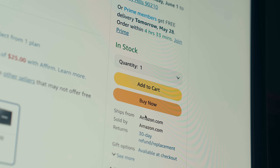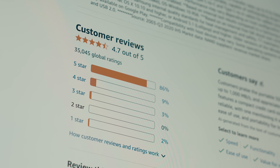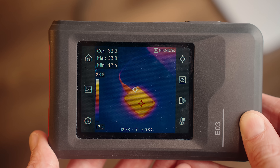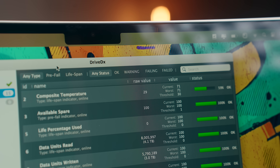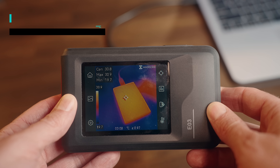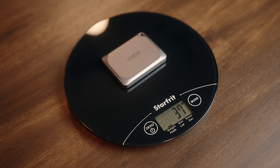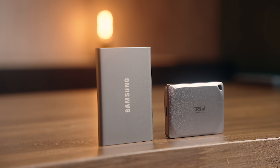The nice thing about these drives is you can just buy them and they're ready to go without any additional steps or assembly. The two specific ones I recommend are the Samsung T7 and the Crucial X9 Pro. They're both really reliable products with great build quality — both have an aluminum construction which is good for durability but also with heat dissipation, which can be a super important metric. SSDs can run hot, and while the max operating temperatures hover between 75 and 85 degrees Celsius, temperatures that sit just below that can affect speed and lifespan. I've had cheap plastic SSDs fail from overheating, but under load these ones stay under 40 degrees with zero issues after years of use. They're also lightweight with small form factors. The X9 Pro is the smaller of the two and it does have an IP55 rating, so if you're exposed to the elements often that might be the better option, but honestly they're both outstanding.